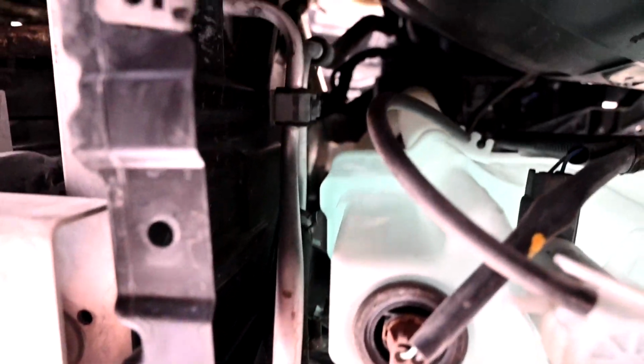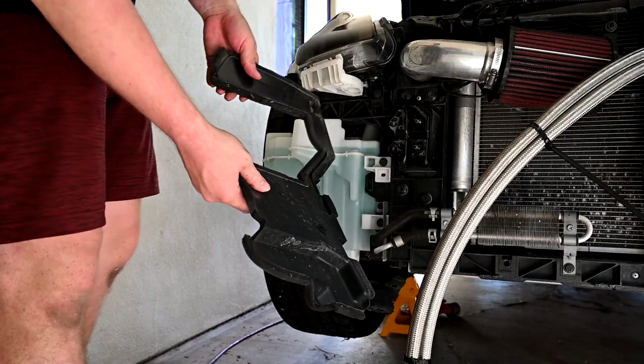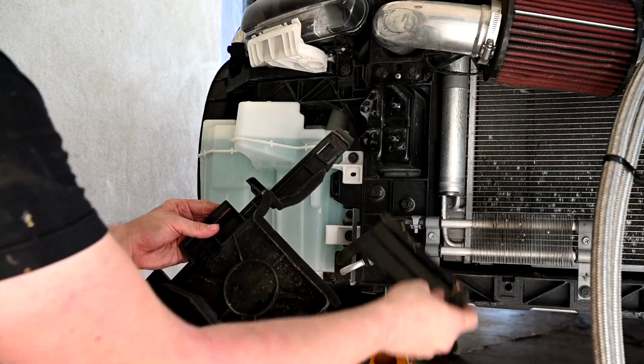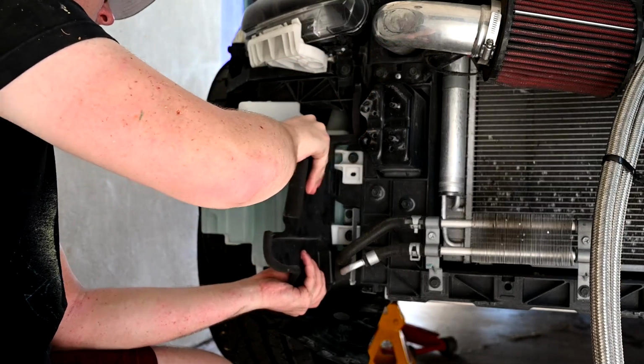Next, under the car, there is a bracket that we have to install. It's not that one, unfortunately, it's the one behind it. There you go. And it needs that little white spacer there in the middle so lines can route between it and the frame rail. Also, this plastic piece on the front does need to be modified. We need to take off this top portion of it so that there is room for those lines to route. But then it gets snapped back on.